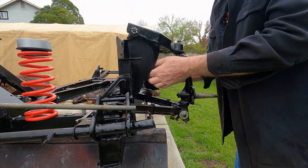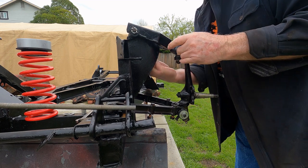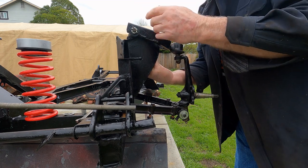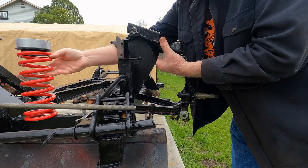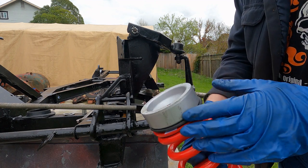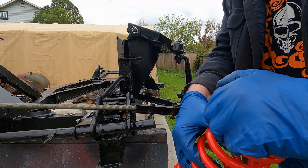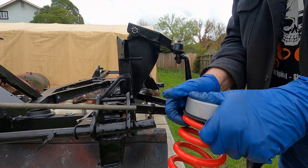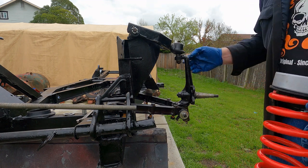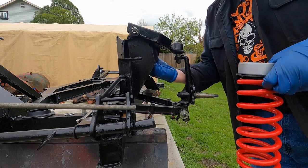So I'm going to fit the rubber up into the cone. There's an inner cone here. The cone is designed to accept the spring, but instead we're using the spring spacer. And that should stay there. I put just a little silicone grease on the rubber so that it would slide into the spring, otherwise it just hangs up. You need to push it down. And it's going to want to come out because it's tapered, but it's okay. Then we need another ring up in the tower.